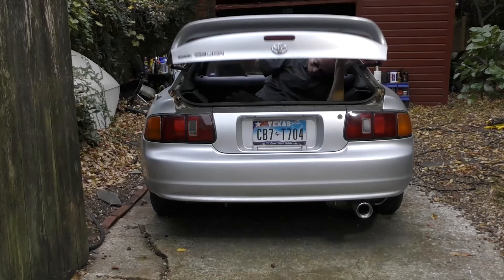Here are some bonus questions and answers. Actav says: can I put a used or new TCM without reprogramming it in a new car? No, not unless your car is a really old used car. Some cars like Honda, as early as 1995, had ones you had to reprogram or the vehicle wouldn't start. All modern cars need that done. Mechanics can do it, and certain companies like NAPA can also program many different cars — they can do GM, Ford, Chrysler, Toyota, though not all like some Lexus. Call around to see what people can do and which ones they support.